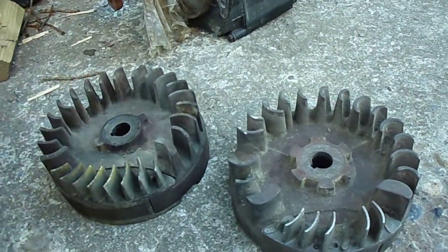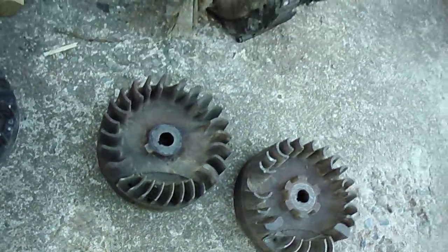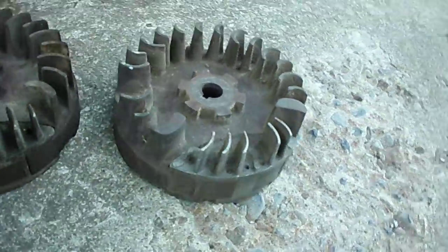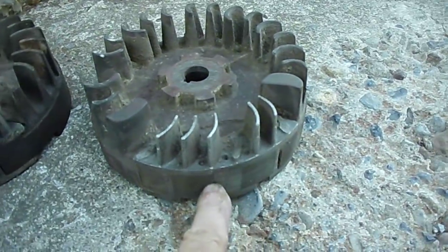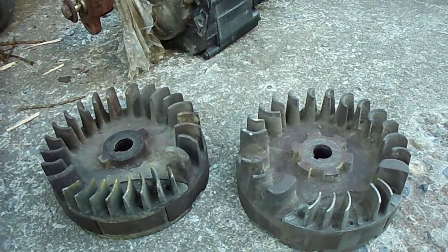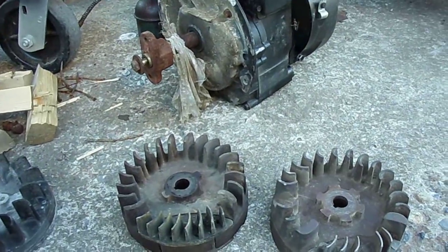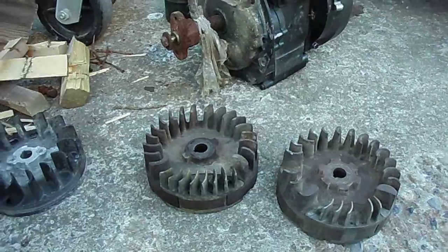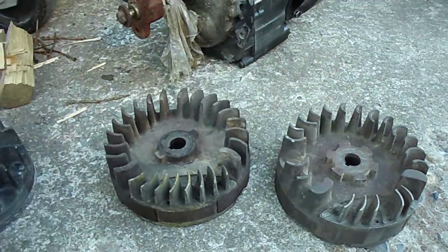That's quite a variety of flywheels over the years. I've been stung by the two-magnet versus one-magnet issue because the two-magnet flywheel won't fire a magnetron electronic ignition, and it also won't fire the newer two-bolt style magneto even with points. I learned that one the hard way - I even sandblasted and painted one flywheel and then found out it wouldn't work.